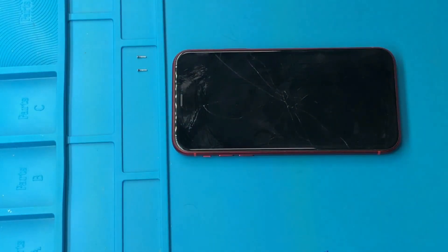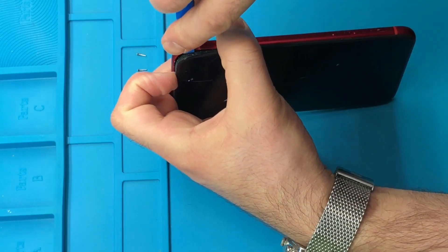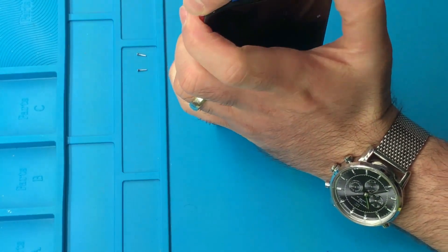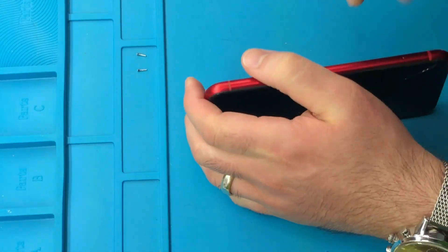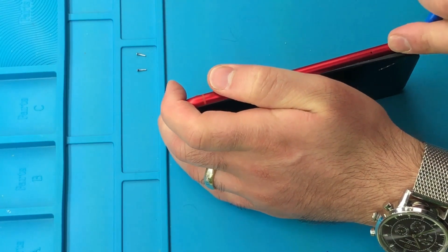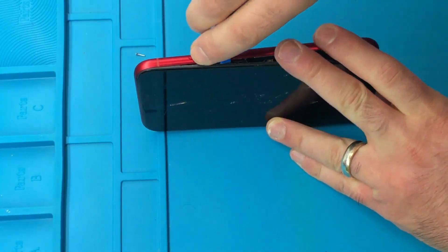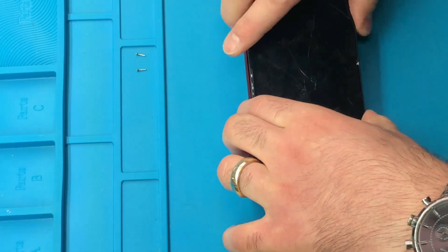Don't worry, I'm going to show you everything — how to do it. Just follow me. What you want to do is use your plastic opener tool and put it on the edge of the iPhone screen, then slide it from side to side and to the bottom and to the other side. If at any time while you're doing this you feel like the pry tool gets stuck anywhere, that means there's adhesive under the screen. It's just hard — give it a little bit more heat so it gets loose and you can open your screen very easily.